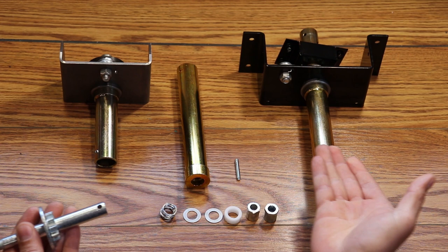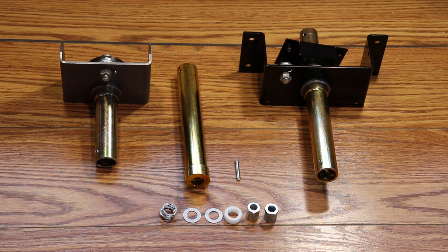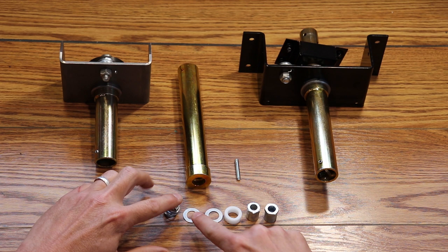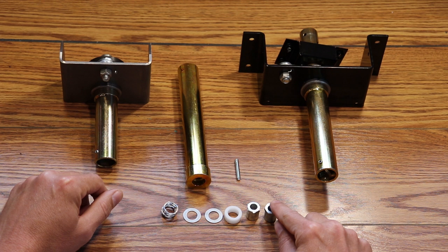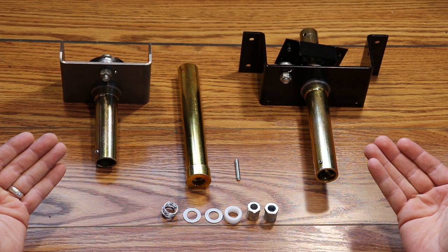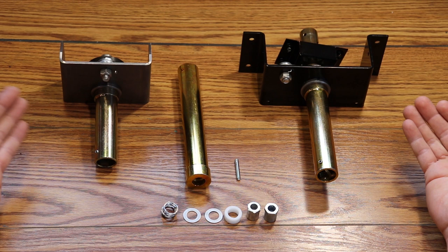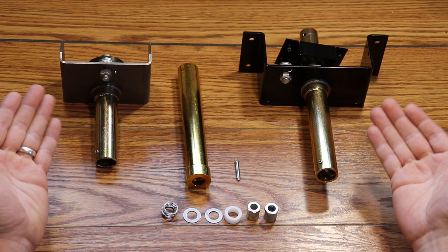If the problem has not been permitted to occur for a long time, it is typically just the drive hub tube threads that experience the damage. Now, these small parts inside the tube — what are they doing? Inside you should find the spring, flat washers, nylon spacer, and one of these nuts. These act as a limiter for the thread engagement. With the parts installed, typically only about a half turn is required to engage and release the compression system. Without them, the tube is allowed to walk further on the drive shaft and can quicken thread damage as more metal-on-metal movement is permitted.